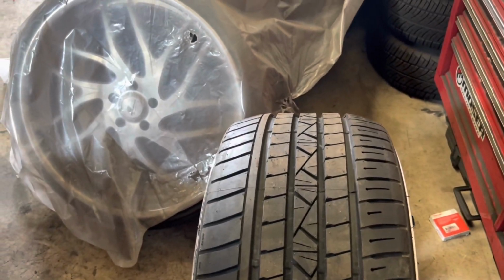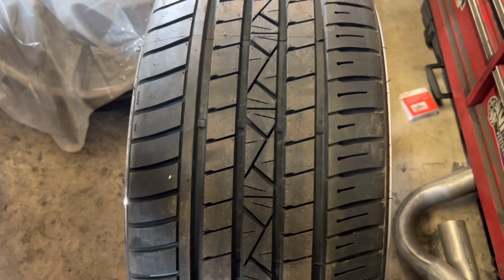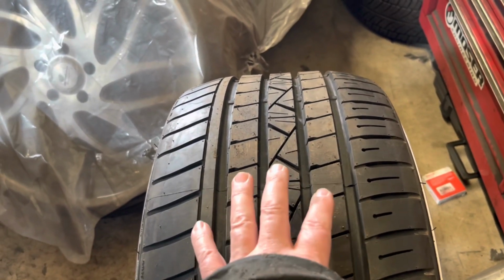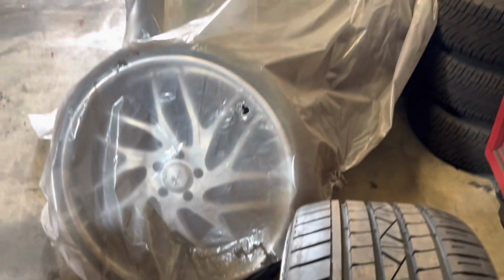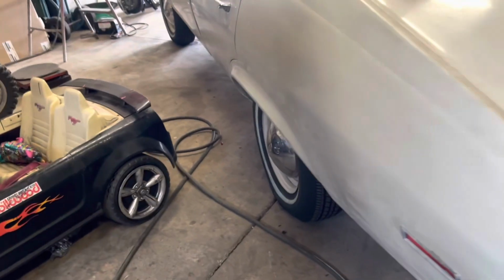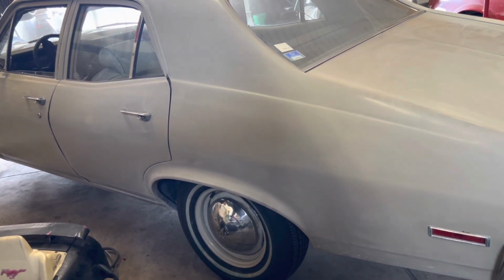But being 12 overall, obviously you've done plenty of cars with being a 12 and 13 overall. So yeah, there's still a lot of people out there that just don't understand that. From this back edge of this lip to this, if you put a tape measure on here, any wheel, whatever, and it measures 12, that means it's a by 11 because of how this curves out. Even your stock wheels, the Nova, for example, right here, that wheel is a skinny wheel right there. So that's probably a 14 by 6. It may be even skinnier than that, but it's gonna measure by 7.